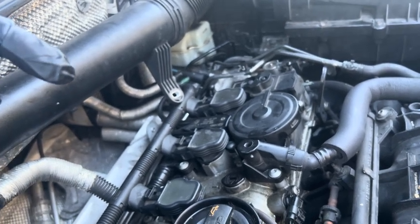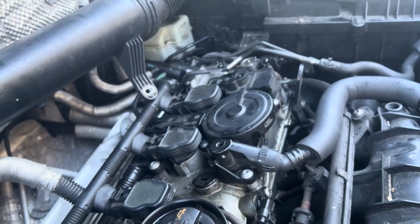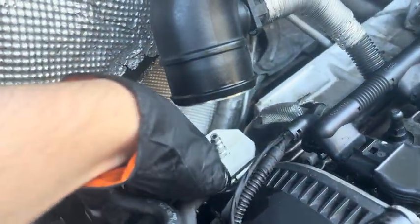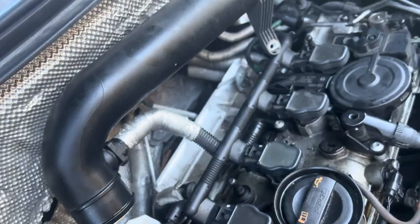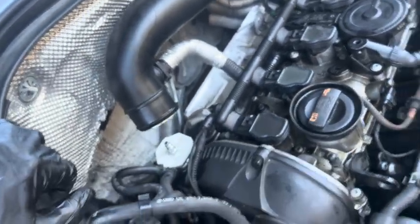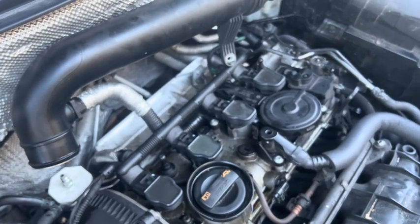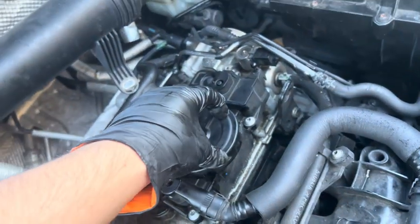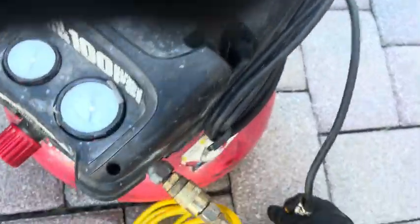This PCV is only about a hundred dollars with new hoses, so I'm going to go ahead and buy that because I believe that's what's failed and caused my P0299 code. Please look in the description — I'll put there whether it actually successfully fixes the issue. But before you buy a whole $1,200 turbo, I really recommend doing this seven-dollar test if you have a compressor. I'll update the forum thread I commented in after I swap out the PCV.